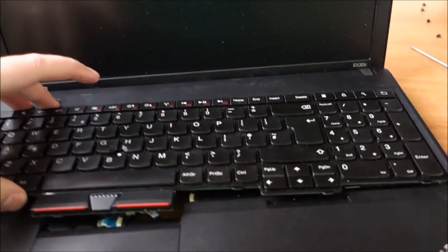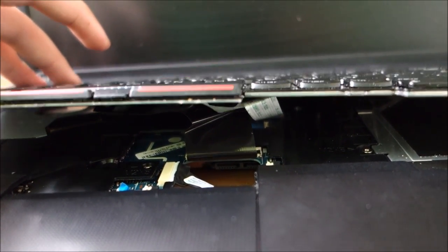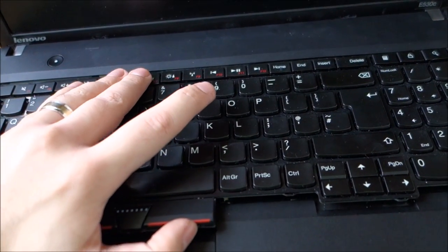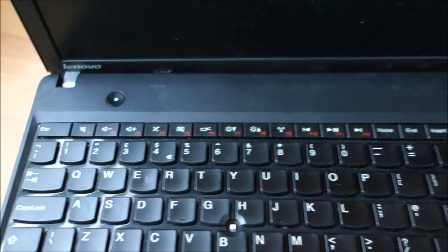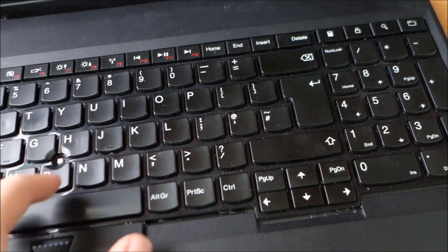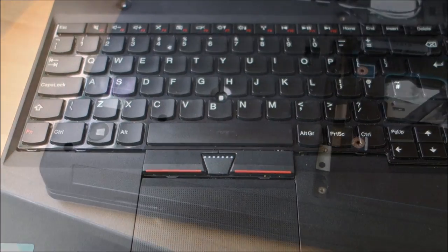The keyboard is in. There are two flat flexes. The thin white one and the black or brown thick one. Or wide one. And basically, to put the keyboard in, you have to slide it in the top part, but most likely I will be unable to do it with one hand. It went in. Then you push it down in the lower part and make sure all of these go under when you slide it back down. But with one hand I'm unable to do that.